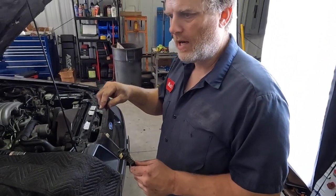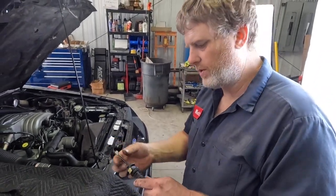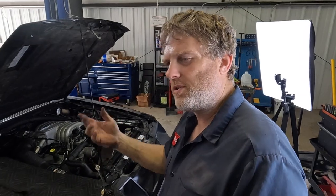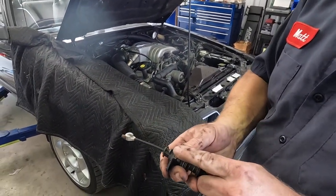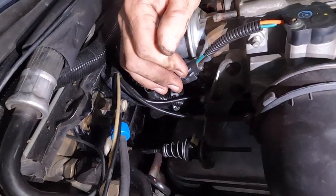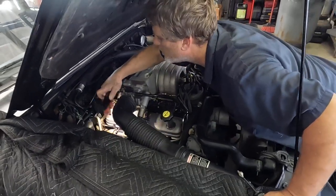You take that plug out, put a pressure gauge in, and there's a tool to set it — you want to read 30 PSI with the throttle cable pulled, and zero with it off. But an old Ford tech told me you can skip all that: just hook it up, and where it sits at neutral, lock it right there. Millions of cars went down the assembly line that way. You're just going to push this lever forward until it snaps down and locks. There you go — you now have a new throttle valve cable. Don't break this one.